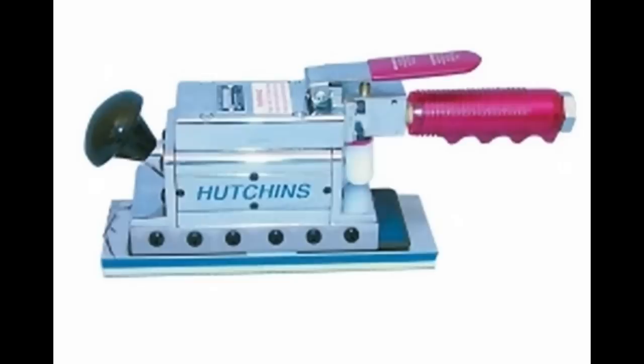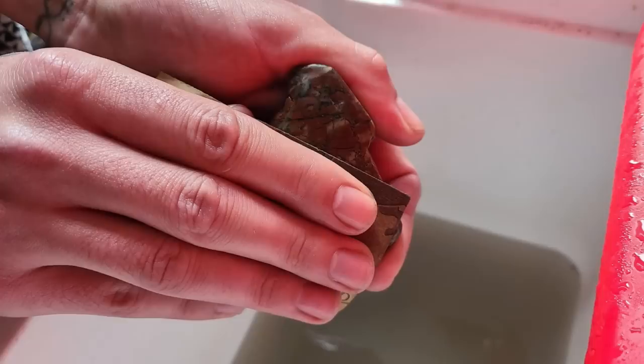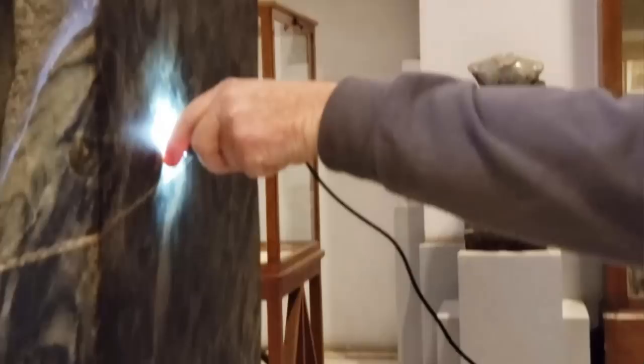Some types of mechanical vibrating sanders, such as the sort commonly employed by professional body shops, leave straight or cross-hatched scratch patterns anywhere from 30 to 50 degree angles from each other, typically with short stroke lengths of only a few millimeters. Hand rubbing with sand and water or quartz grain impregnated cloth or leather leaves a scratch pattern that is random, semi-circular, and varying in stroke length, radii, and direction, and tends to follow irregularities in the surface contour rather than equalize them.